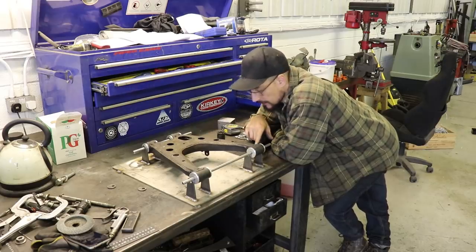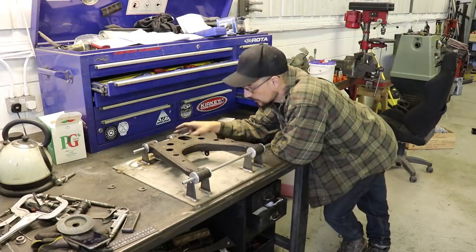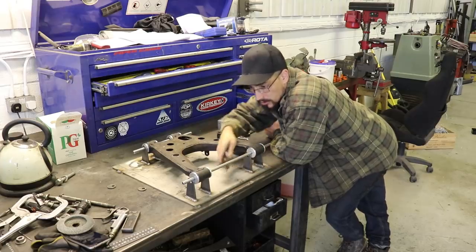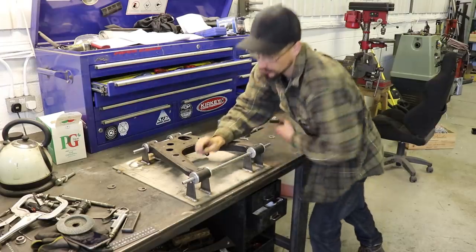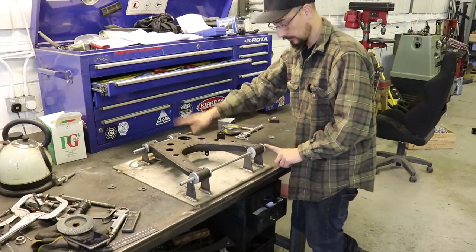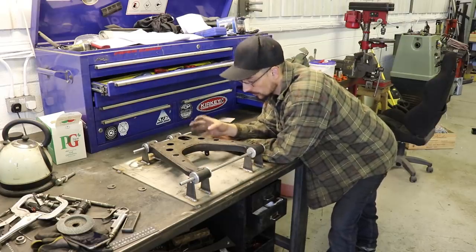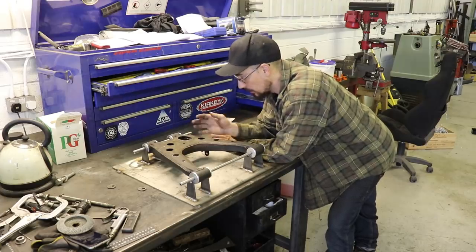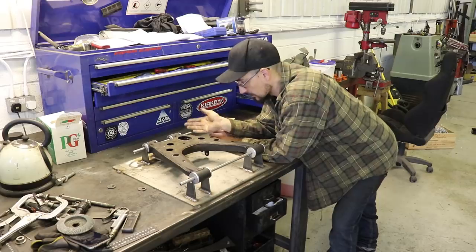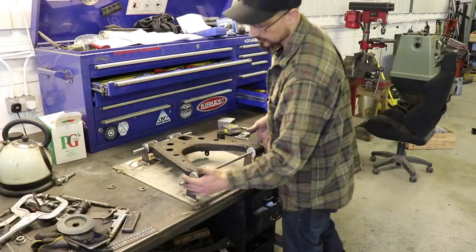And that is because the bushes obviously weren't sitting perfectly true inside their tubes here. So I've ended up having to machine down some bar to the 12mm here, 14mm here, and set it all up like that so that I know that everything's dead square, because I couldn't get it all perfectly square so it would just slot in both ways with the original bushes or with the poly bushes. So by doing it this way, I've managed to get it all welded together, and I can flip this and this end of it still lines up.